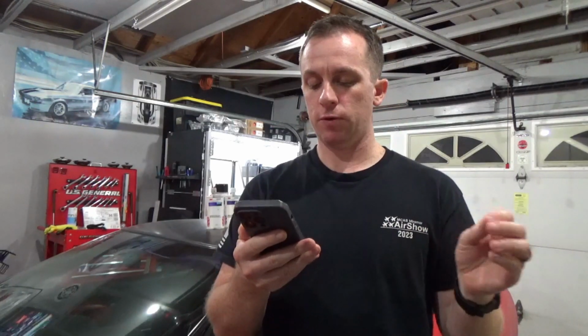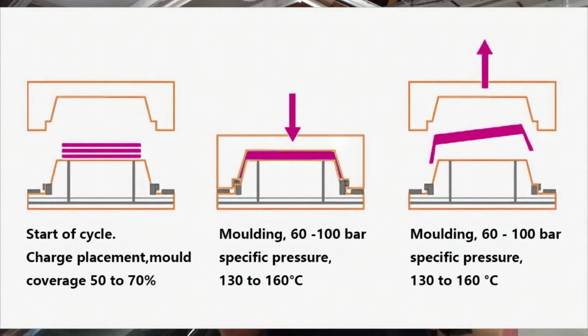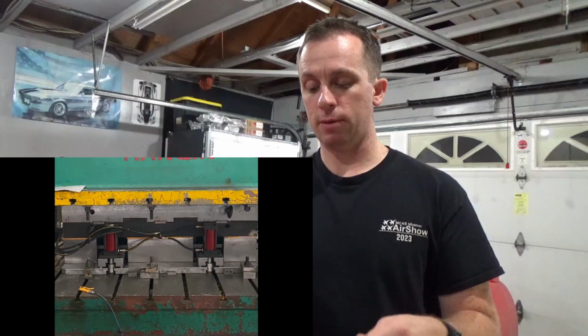The sheet is either rolled into a 1,000-pound spool or festooned, I've never heard that word before, in a large box like taffy. At the end of this maturation, the SMC becomes as firm as modeling clay. The protective sheet is peeled off and the SMC is cut into sections called charges, which may be several layers of SMC thick, and is ready to be made into a vehicle part. A charge is then inserted into a two-sided heated die where it is pressed at 1,000 pounds per square inch at about 300 degrees Fahrenheit in about 2 minutes to mold the part. A lubricant built into the material helps to demold the formed hardened part. It is then ready to be trimmed and painted.